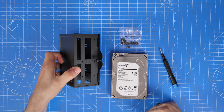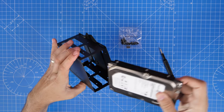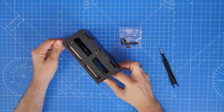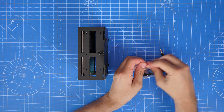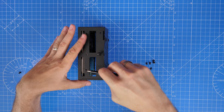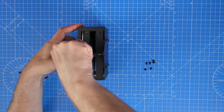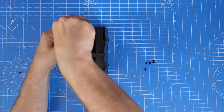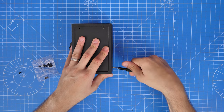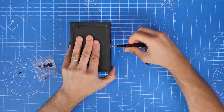For hard disk drives, they basically just slot into the tray and are screwed in — you line up the drives with the sides and use six screws on either side. You can fit two drives into this caddy, then replace it back into the case and connect up the relevant cables: SATA power from your PSU and a data cable to the motherboard.